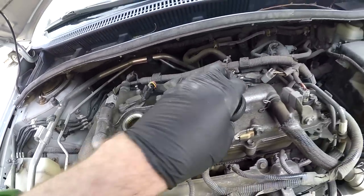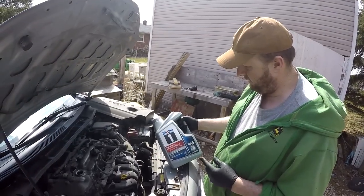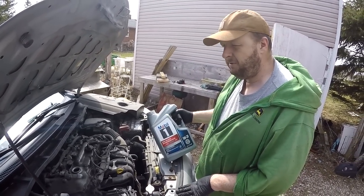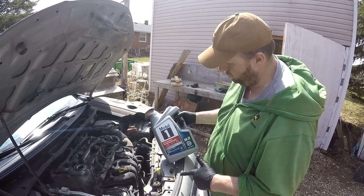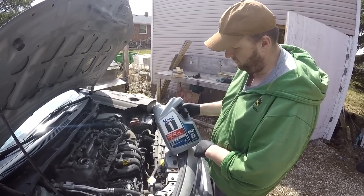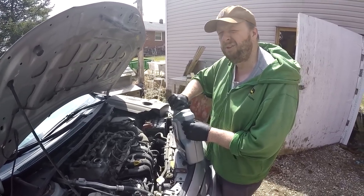It's getting kind of tarnishy looking in there. Okay, let's get some oil back in here now. I'm going to use some of this high-mileage stuff — that's what I used last time and it actually seemed to slow down the burning a little bit. This is Advanced full synthetic. We're supposed to use a 0W-20 but because this is getting a bit older I'm putting a 5W-20 in just to help maybe a little bit, and it did sort of seem to help slow down that oil consumption.